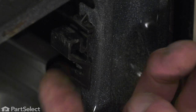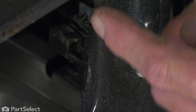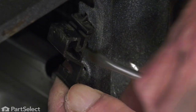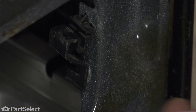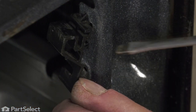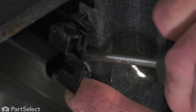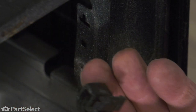Simply remove the retaining screw. Now, with that screw removed, there is still a little arrowhead fastener that attaches to that opening. You may or may not be able to get at that with a screwdriver or a pair of needle nose pliers from behind. If you can't, you can simply pry it upward and then unhook the top of it. That will probably break that little clip, but it's just to position it anyways.